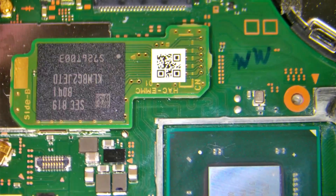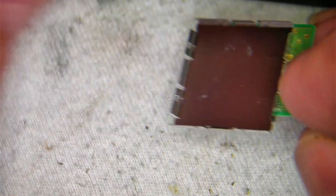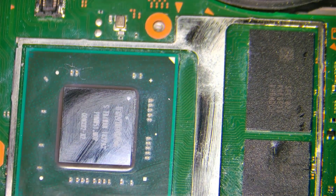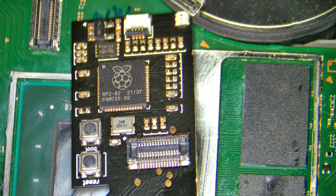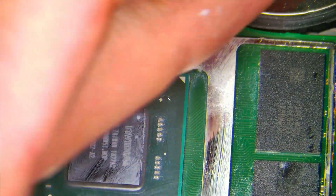This thermal paste will not interfere with any other connectors — it's not conductive so we should be fine. We're going to start by removing that chip here and remove the metal piece from it. Now we're going to cover the Wi-Fi and Bluetooth chip. Just to eyeball things, we're going to be putting this chip here — this is the RP2040 chip. They're pretty cool and pretty easy to install, especially in this model. We don't have to worry about the point on the back — pretty straightforward.